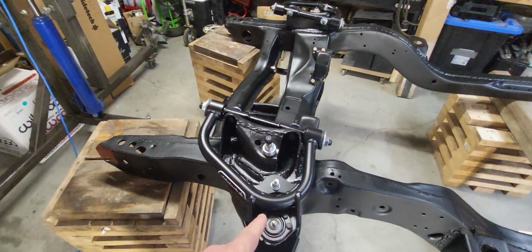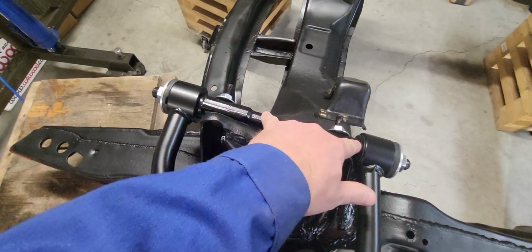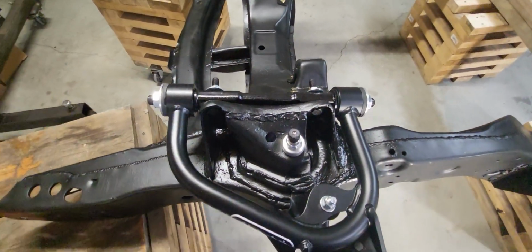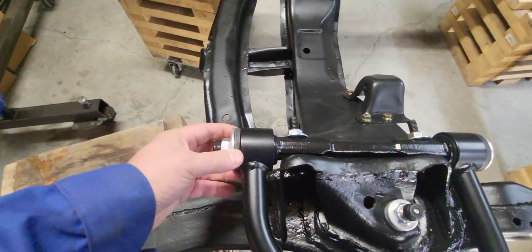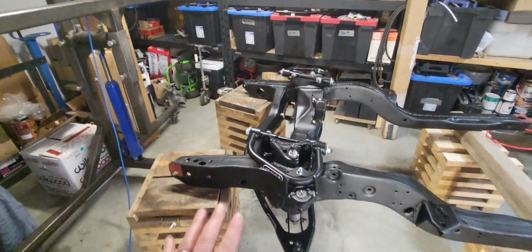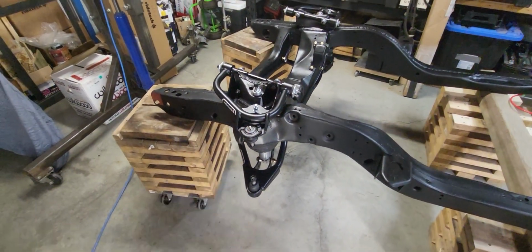Okay, I got the upper control arms mounted here. They're looking real good. Those caster slugs are in here to make this normal. They're ones you can buy that move this forward or move it back. It's as well positioned in the out position. If you rotate this guy over, then it brings it to the in position, which is more designed for racing, increases the camber. Also tightened down the cross shaft nuts here so that they're making good contact with the Delrin bushings. It still moves by hand, so that's all fine and dandy. I also pulled it off the rotisserie because I think this thing's going to start getting heavy pretty quick, and it may prove to be difficult removing it later. So I got it sitting here. Next, we can move on and put the spindles on.